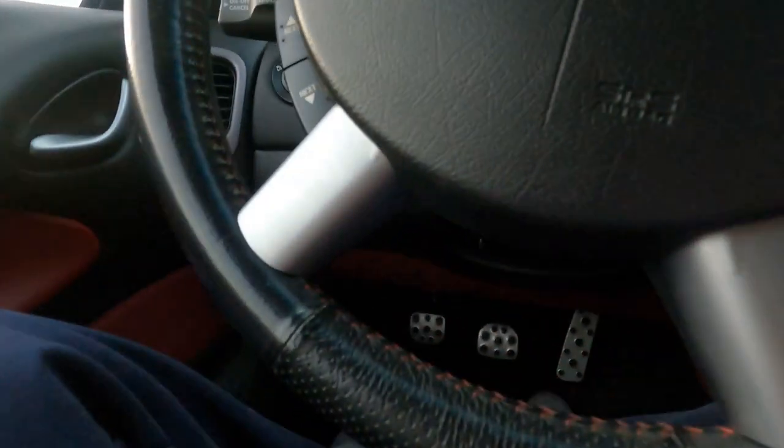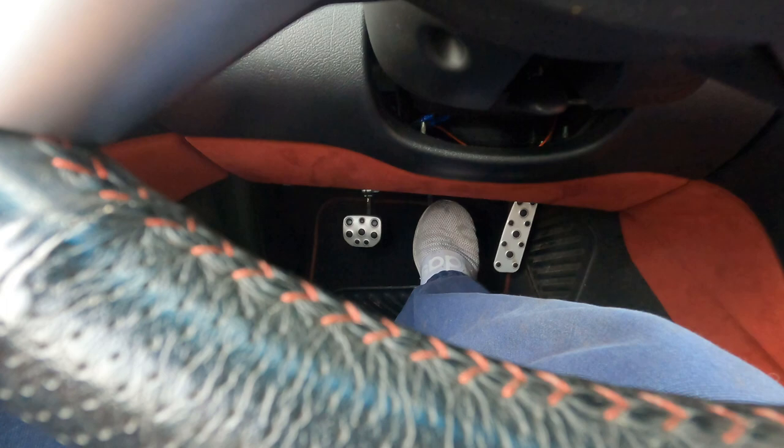That should be how you change the brake master cylinder. We'll find out tomorrow because it is about to rain and it's getting dark, so I'm going to flush the system out tomorrow. The brake master cylinder is in, brakes are bled — nice firm brake pedal! Got brakes now. That pedal is a lot better than it was, so I'll say right now I have a 99% chance of having brakes. I'll take that — way better than it was.